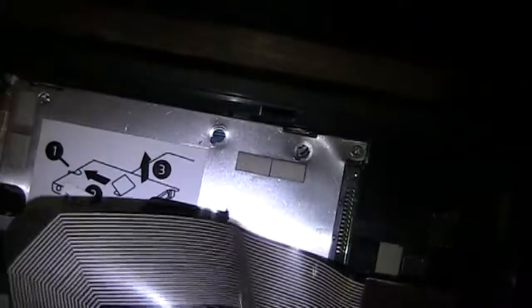What I have in here is a 750GB hard drive — a regular 2.5-inch notebook drive. I got this for 10 bucks because it didn't pass its SMART test. Some systems, like a Compaq NC6515B I tried to put this in, would show a message saying the hard drive didn't pass the SMART test and press F1 to continue — but instead of continuing it would take me into BIOS and I couldn't get out. With this particular BIOS though, I get the message, press F1, and it actually continues into the operating system. Sometimes you can go for quite a long time with that SMART test alarm before anything happens to the hard drive, and for our purposes here, that suits it pretty well.